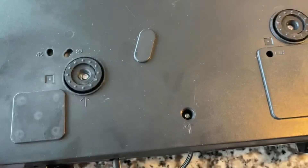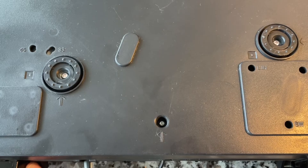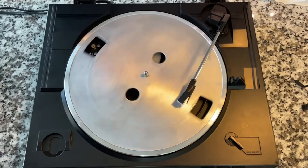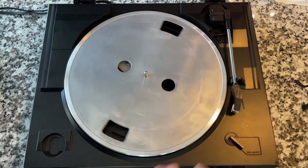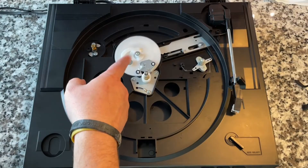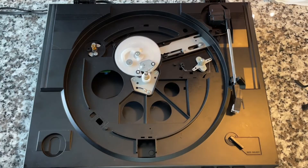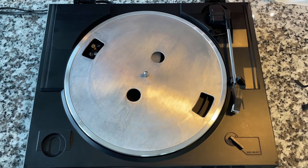I don't want to be repetitive — we've talked about all this stuff before. Let me finish putting this back together and we'll give it a test. Got it back on and it's thinking that it is in a certain position in that cam gear. The cam gear has slots in it kind of like a maze on the bottom, and that's what tells it where it's at, where the record's at, all that stuff. So it gets a little confused when you put it back together, but it is working.